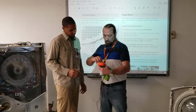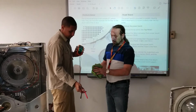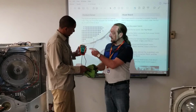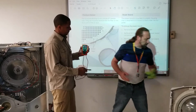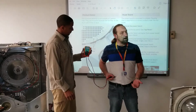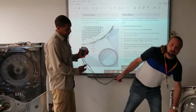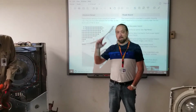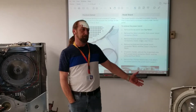Ohms. So we're going to go on the highest ohm scale here, 20 mega ohms. And if we just touch the wet rag with both points, you can see he's getting a reading on the meter. And if we took a dry cloth, let's just say like my shirt, and I touch my shirt, what kind of resistance am I getting? I'm not getting any reading at all. So the board would see that moisture. Whenever the wetness touched these two bands, it would know how wet the clothes are, and it will extend the drying time accordingly. Give me some problems that could happen with this dryness sensor.